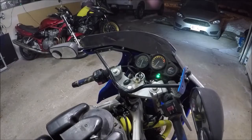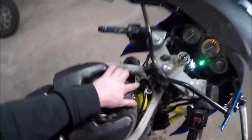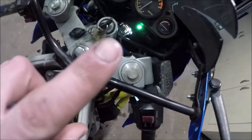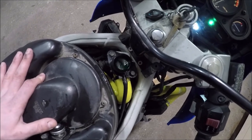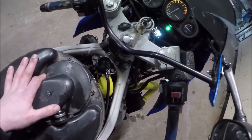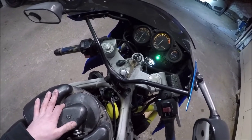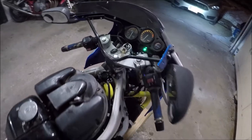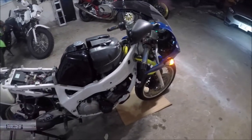I'm going to start it. I don't expect this to go well. I did get it started after a couple of goes — the GoPro froze right as I hit record. We made a carburetor change — we changed the air-fuel mixture screws. Now I'm watching to see if any bubbles actually come through. Choke is fully off now. I did just get a bubble to come through. I'm watching to see if more bubbles work their way through while I warm the bike up, but I'm not seeing a whole bunch. I'm not seeing any leaks so far — that's good news.